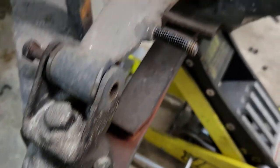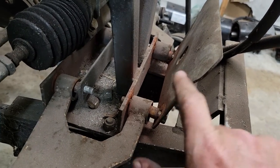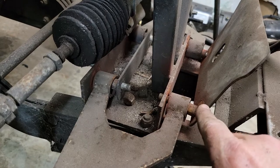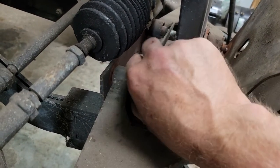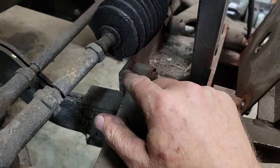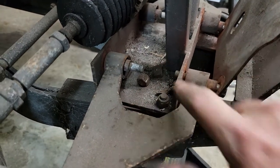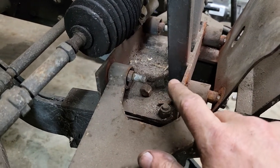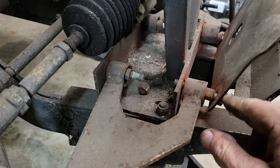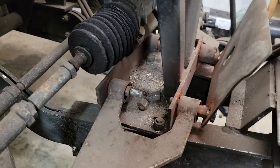Up here on your plate, apparently on a carry-all it's got this big heavy plate. On the back side, we're going to retain the three-eighths holes that are here on each side. And on the thin plate, retain the three-eighths hole — do not drill these out, that needs to remain three-eighths. On the back side, we're going to drill a half-inch hole in the thicker plate. And in the front, right here, we're going to drill a half-inch hole where the three-eighths hole is. That's going to allow us to have a better hold on this frame to our upper control arm, and we're not going to be relying on this real thin plate to hold that bolt secure.